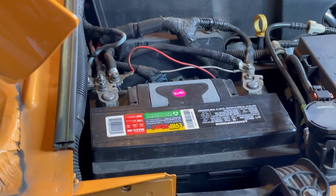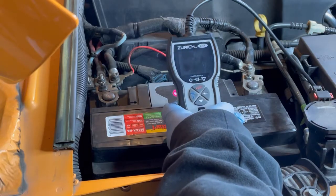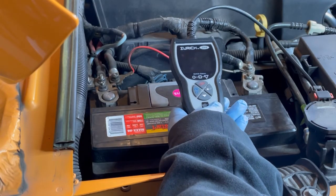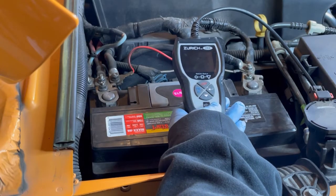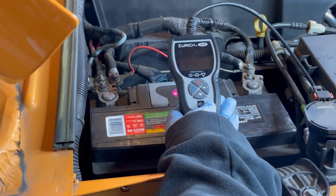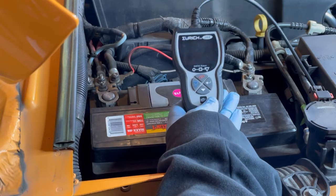I've been asked in the past: how do you reset the code once you have it fixed? It's been my experience that once you reconnect the battery, it resets the code. And if you didn't fix it, the code will pop back up again — that's been my experience. I'm not a mechanic, so I don't even know if that's the correct way to do it. The other thing you could do, which I would highly recommend especially if you're going to be doing DIY projects like this a lot, is to invest the money in one of these scanners. I picked this one up for $30 at Harbor Freight and it does great. You can spend over $100 on one — there are a lot of options. I'll link a few from Amazon in the description below. With this tool, once you plug it in, it will give you the option to erase the code. You can erase the code, and if the problem's not fixed, the code will pop back on.